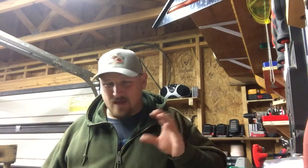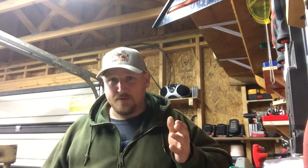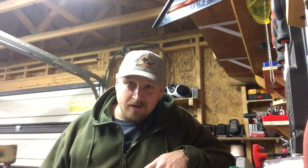I've got a weed eater from one of my best friends' father-in-law, and it's a Stihl FS55, and he said 2 years ago the local Stihl shop put a carburetor on it and it hasn't run right, and so on. He said, will you look? I said, sure, I'll look at it. The carburetor is one of them OEM carburetors with one screw adjustment to adjust everything. I hate them things. The 017s had them, and the MS 180s, I despise them things. I bought him an aftermarket carburetor with a new fuel line, new fuel filter, everything, parts, labor, everything, and it cost him about $20. It took me no time to do it, and the thing runs like a top. Now, will it outlast the Walbro that he bought at the local Stihl shop? Probably not. But I would say this one would last as long as the last one that he got down there that ain't run right since he got it back.